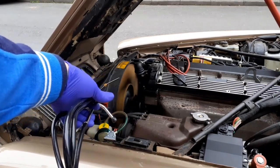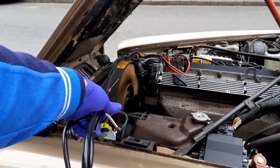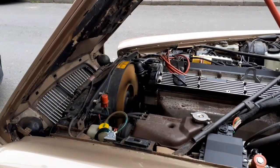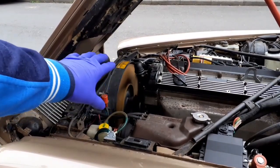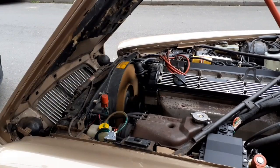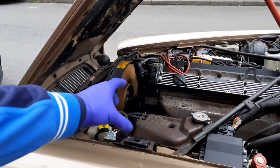Obviously if an engine turns at 3,000 revs and that fan turns at 3,000 revs, it will disintegrate. The blades can fly off, and it's only made of plastic, and it just cannot stand. They probably only turn at a maximum of, I don't know, 1,250, 1,500 revs. Even if the engine's screaming at 4,500 revs, the fan will slip. There's like a coupling,